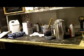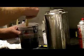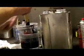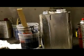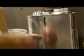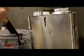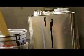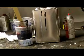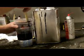Showed this before, but here's a paint can, and you can see there's grips all down the side of it. Test to make sure that your viscosity is decent. Let's turn this sideways because that side's dirty. That paint's a little cold. You can see how slow that's running. When that paint's warm enough, it should run to the bottom of that can. Probably 5 minutes in there, I'll be fine. There's only about 4 or 5 ounces of paint in here, so it should warm up pretty quick.